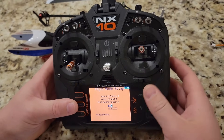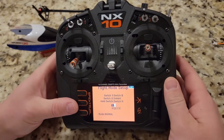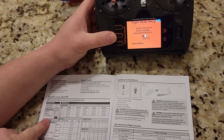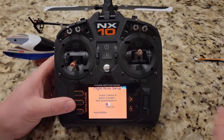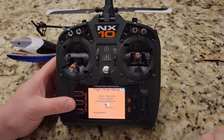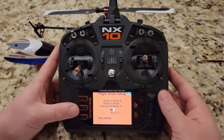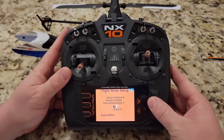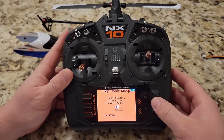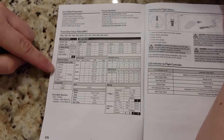Why would they want the warning in the wrong condition? So I'm going to go back into flight mode setup. I want the warning if it's off, not if it's on. So I need to find where the warnings are. See this — I want it to also warn for anything other than normal, because that would mean you could at least have the stick low. Now I'm going to test my theory — throttle hold is off. I'm going to go ahead and shut this down. I'm in a dangerous condition because the rotor could start. I'm going to turn it back on.